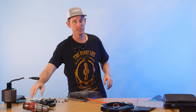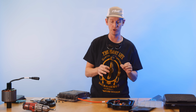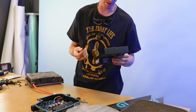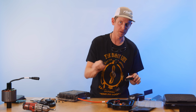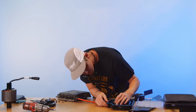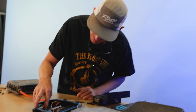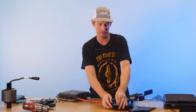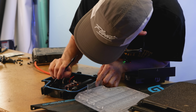Man. Okay, now before we close up the controller module, we definitely wanna test and see if the GT Surestart Pro fits in this thing. Alrighty, so here we go. Let's get this guy installed. We're just gonna dry fit this guy before we go scraping conformal coating off, just to make sure that it still fits. Looks like it snaps in. I'm not seeing anything that blocks it, so that's good. Whether or not it still actually works, we're gonna have to find out. So let's go ahead and scrape that conformal coating off, get a good install like we're supposed to.